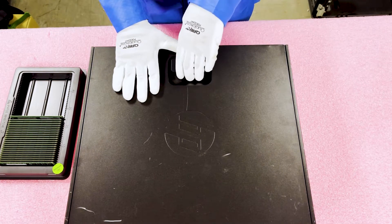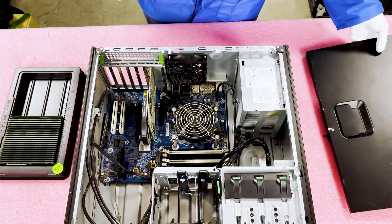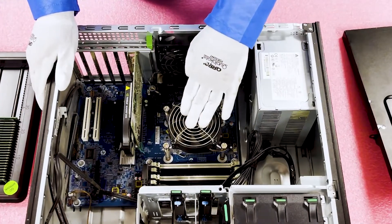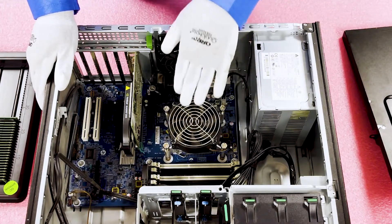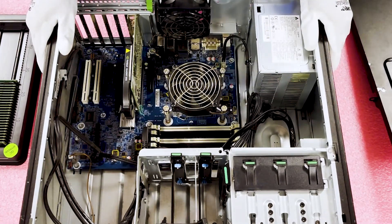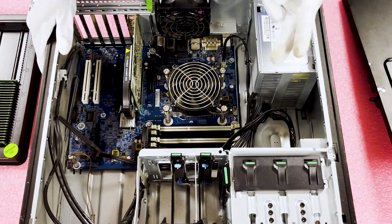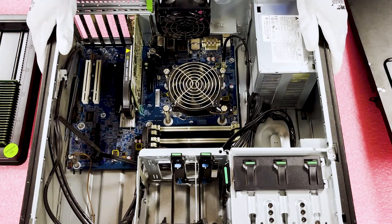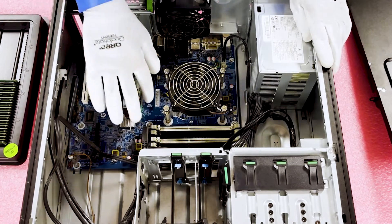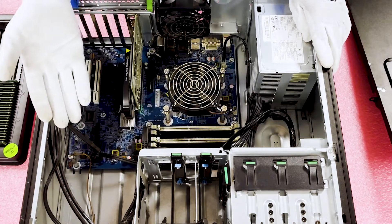This is very simple. You're just going to lift this up, grab the top straight up — comes off nice and easy. As we discussed earlier, you're going to notice there is one CPU. Currently there's a heat sink and fan combo on top to keep it cool and prevent overheating, and there are four DIMM slots. You will also notice there are two memory channels with two DIMMs per memory channel. This is important if you're only loading two modules — you would want to load them in the start of the channel, which is the white slot. You would load them in the white and the white and skip the two black slots.